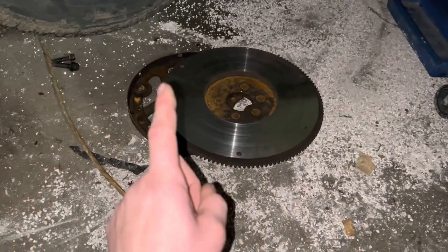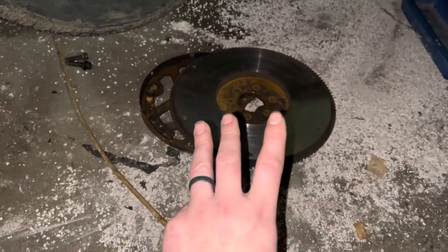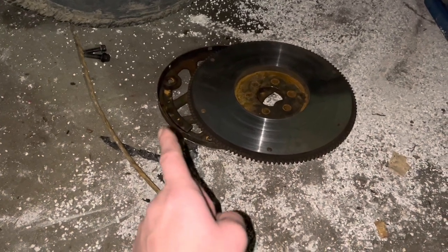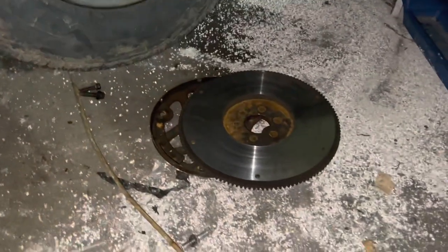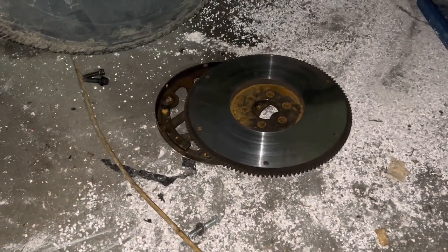You may see small balancing holes — that's normal. But it can't be the 360 flywheel. That is the flex plate from behind a 360 Magnum. If you're doing this with a 318 Magnum, you need a flywheel from a 318 Magnum with no weight. These two components are what we're working with. Now for the flywheel magic.